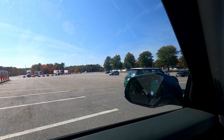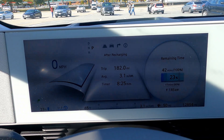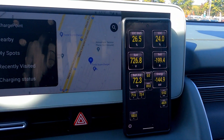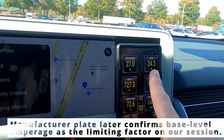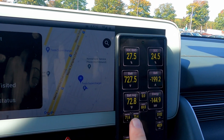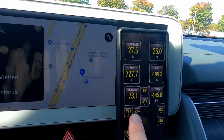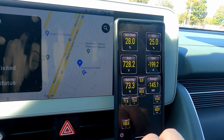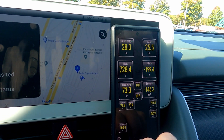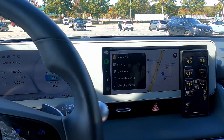So you do have that different level of power available. As you'll see in the charge session, we had a Mini Cooper SE pull in beside us — capable of up to 50 kilowatts, so it was perfectly matched for the CPE 250s. That's pushing up to 145 kilowatts, just topping out around 200 amps and 727 volts at 24% state of charge. Battery temperature's fine, right in the sweet spot. It's one of those bright sunshine fall days, 65 degrees Fahrenheit ambient. This power level shouldn't push the battery too hard temperature-wise compared to a 350 kilowatt capable charger.